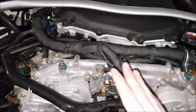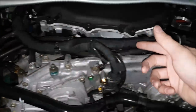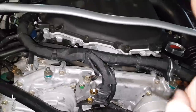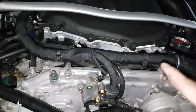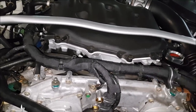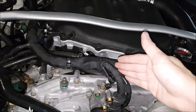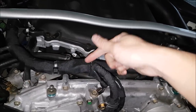I think I have it the way I want it — from here to here has the heat tape covered with exterior Tesa. There are three reasons why I did this. One, my OCD has been kicking in and I need to let it out. Two, if that wire cover does retain some heat this is going to help protect the wire. Three, I've been seeing lately in newer cars rats nesting under the hood. This vehicle is parked in areas where I have a very low chance of that happening, but if I'm parked somewhere not at home and rodents decide to come up here and try to chew at the stuff, they have a lot of layers to go through to get at my wiring.